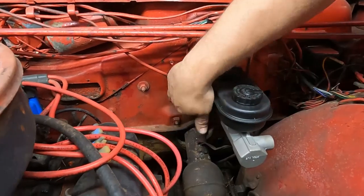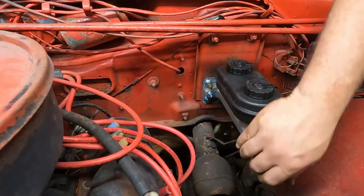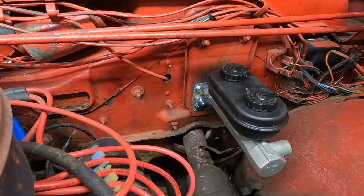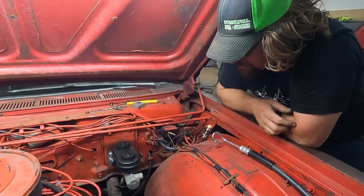As you can see, we've got the original master cylinder bolt positions on the top and bottom, and the new master cylinder bolts right there in the middle. It's nice and solid — bolted into the stiffener plate and the brake pedal mount on the inside. Now we need to start working on our brake lines.